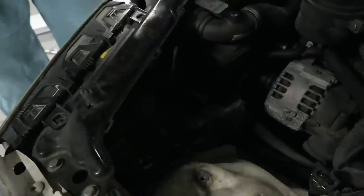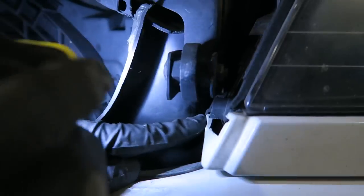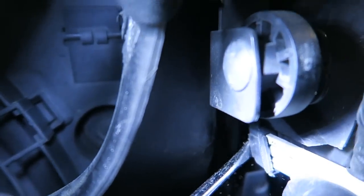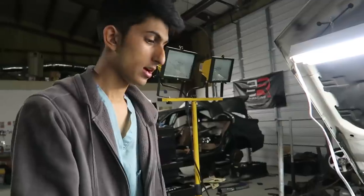I just got both of these bolts out. Now, if you see this trim — it's going to be different if you have a facelift — between the air dam and the headlight there's a little tab that you have to pop out, and it helps to use a flat head for that. Once you have that out, just pull it out — there are tabs all underneath the headlight. Just like that. Now disconnect all the headlight connectors, and voilà — the headlight is out.